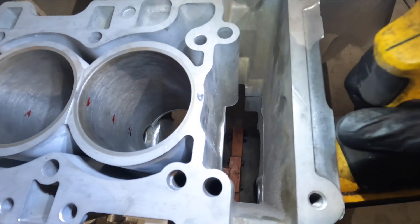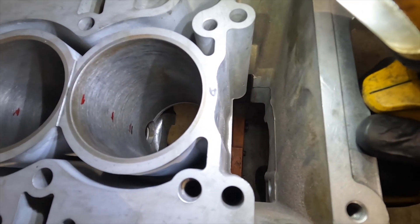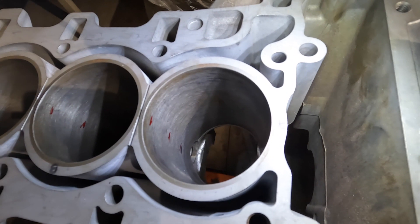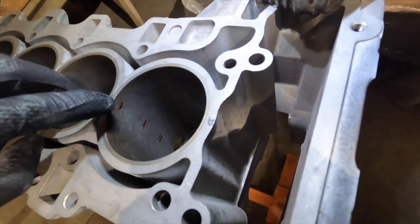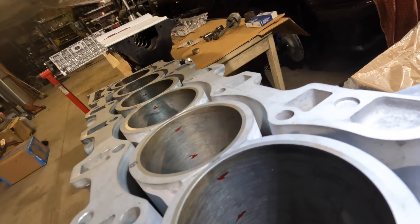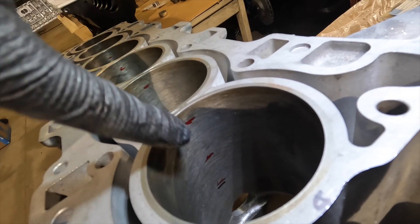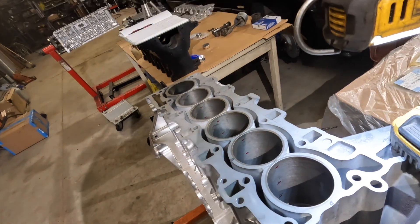I've got three levels of measurement position. I'm going to be checking the ring end gaps of the top ring and the middle ring, and if the oil ring calls for a measurement we'll check that as well. This bore is 84 millimeter and the stroke is 89.6 millimeter. I typically like to measure about 10 millimeters from the top — so the first mark is at 10 millimeter. The bottom mark is about 10 millimeter up from the 89.6 stroke, which is right about 80 millimeter from the top. The middle is at about 45 millimeter, the midpoint between the two marks. We'll take ring end gap measurements at each of those positions.